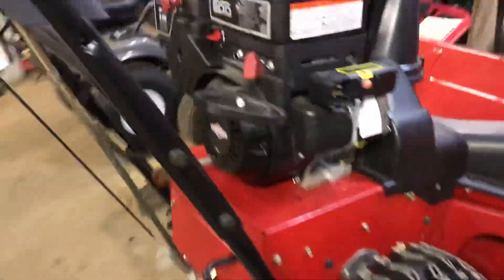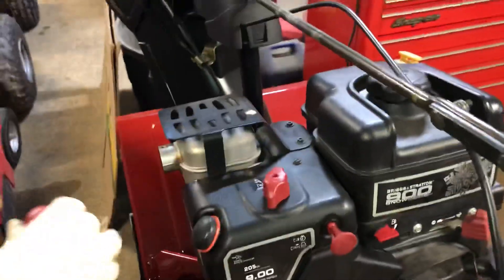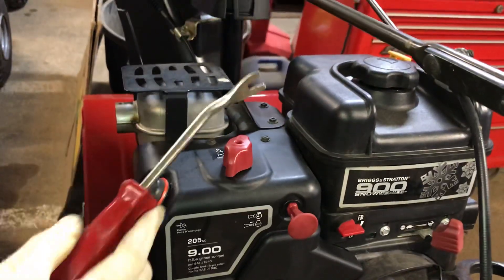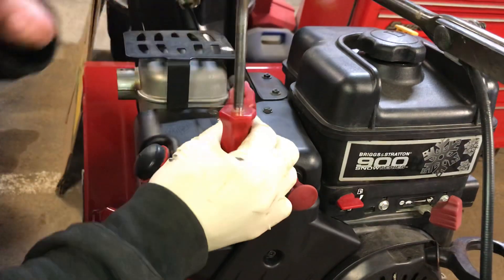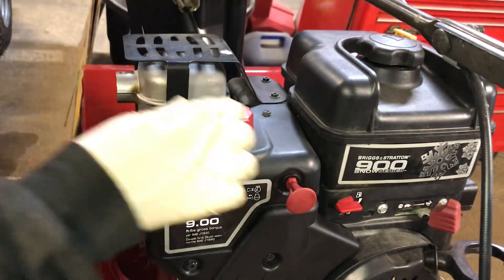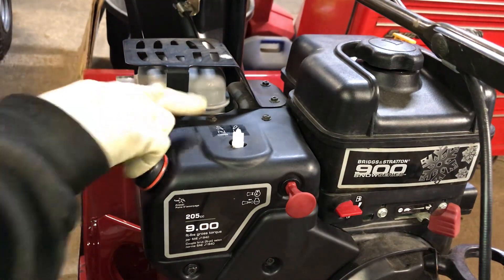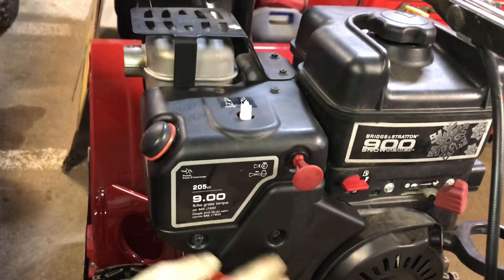The first thing to do is come over to the right, above where the choke is. I have a choke knob — this choke knob can be a little bit tough getting off, that's why you have the fender clip tool. You can just pry under it and it should pop off. Sometimes they get real sticky and tough, but they do pop off. Just make sure you note which direction they came off so you can put them back on the same way.